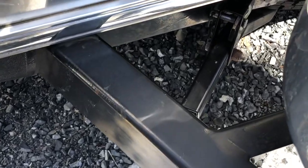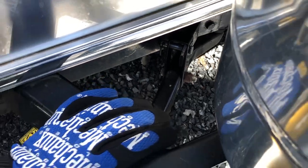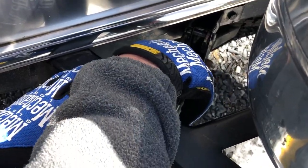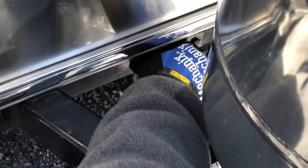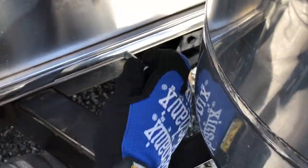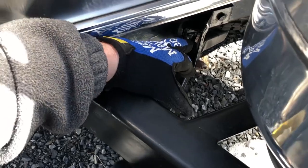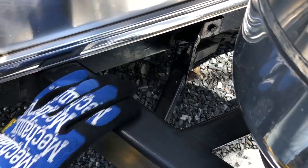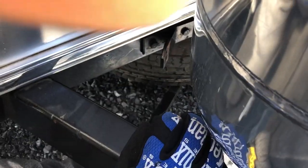We're going to start by lowering the spare tire. You can see the mechanism here is in the front right behind the propane tanks, and the whole mechanism is going to lower down. You're going to start by removing this pin — I use needle nose pliers to make it easier. You take the little pin off, then you slide this mechanism off the post. It's always a good idea to lubricate this as well because it can be a little bit stuck. Hold the handle, slide this off, and then you lower everything down.